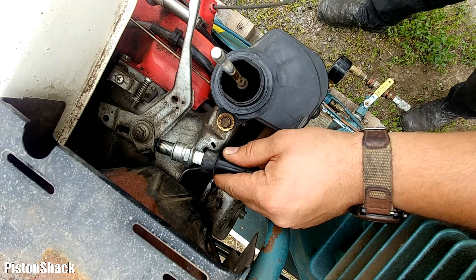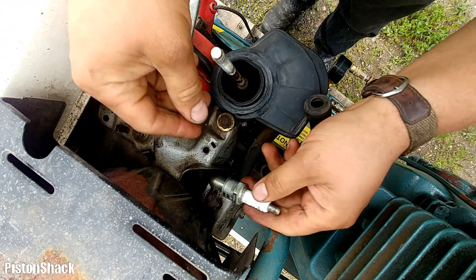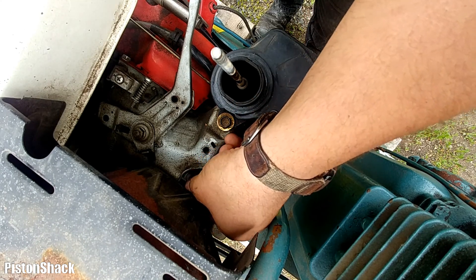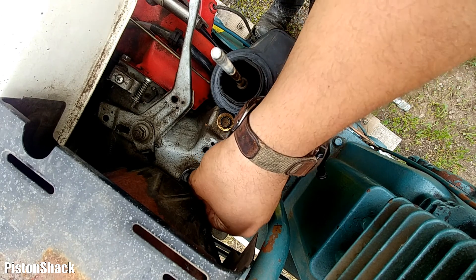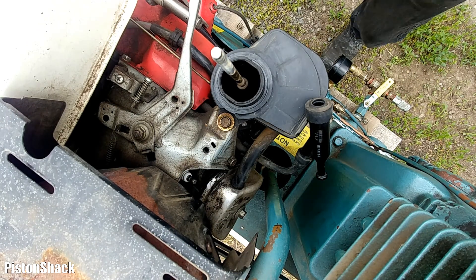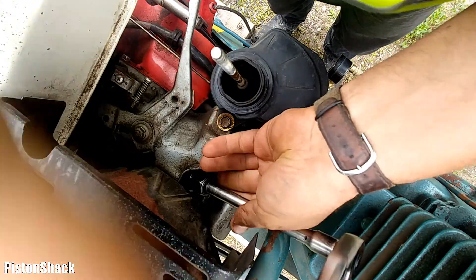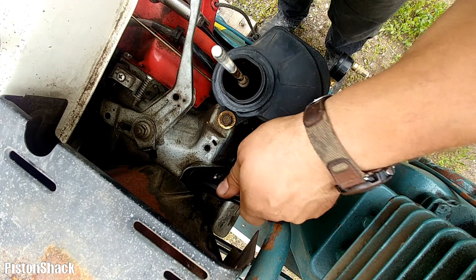This one should help. Let's put the spark plug back in - always start the spark plug by hand like that to make sure it's not cross-threading. Go a few threads first; it's so easy to get a spark plug cross-threaded when you start it right away with the socket because it's hard to keep it straight and it will create another problem. Also remember this is aluminum - don't go too crazy. That's enough. Let's connect our boot.